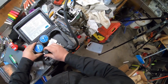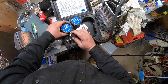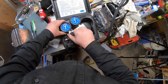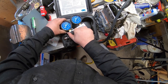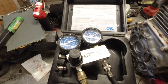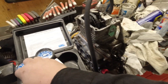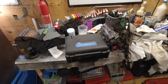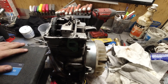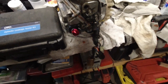This will probably take a couple of tries. Actually the cylinder values are really good — it took up to 80, so you can see right there the values are 80, 79, 78. I am really satisfied with that; we got a good seal inside that cylinder block. The cylinder leak down test proved to me that this engine is solid, the valves are seating, and we're not getting major air past the rings. We're looking good, so now we can continue with the final assembly.